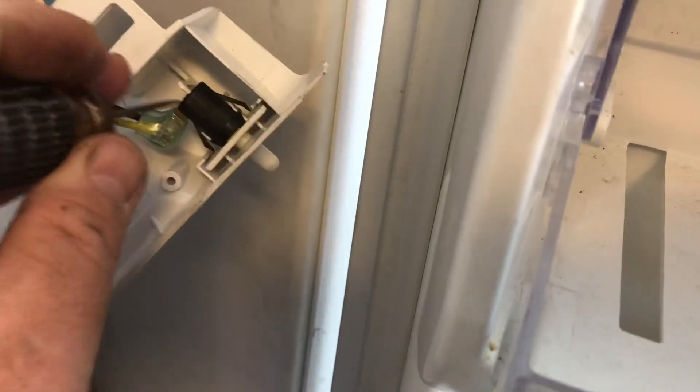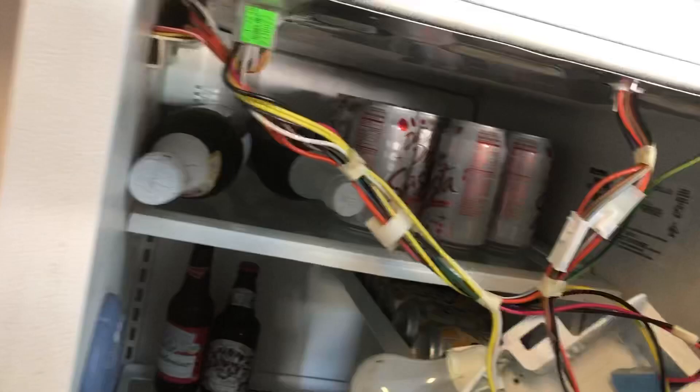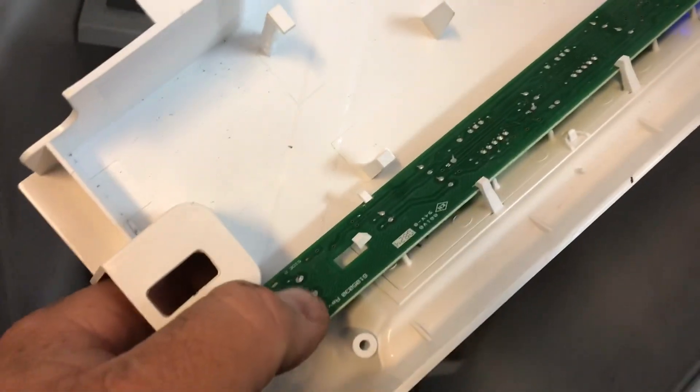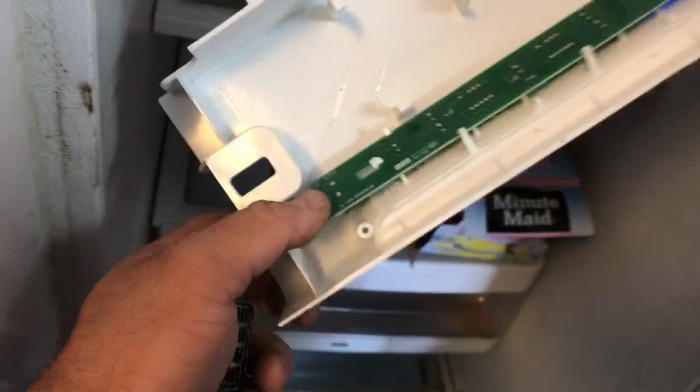So that's it. Hopefully you hear the sound come and go. I tried jumping these together just to see if it was a plunger that was broken, because my bulb is out up here. I know this one's working because the light comes and goes. So there are two different ways. The right way to do this is to solder that up or heat it up, and then that should fall out on its own. The wrong way is what I'm going to do — just pry under it with a thin screwdriver and pray for the best.